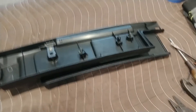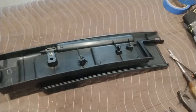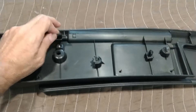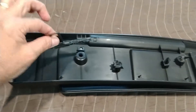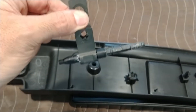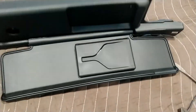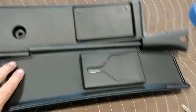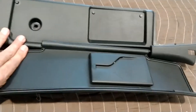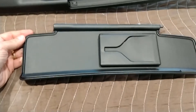In order to remove this sub-assembly, it's pretty easy. Phillips screwdriver right here — unscrew that screw. Once you remove the screw, the little sub-assembly here pulls right out, slides right out. Metal retainer clip, plastic pinion piece. Flip your sub-assembly over, and your visor is held right now by just a little pinion in here. Pull the opposite direction and it comes right out. There's your sub-assembly.